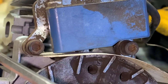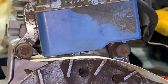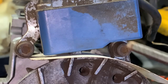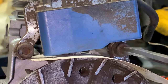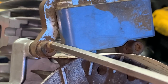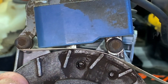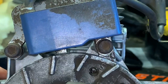That way the natural action of the clockwise rotation of the screw is actually pushing down on the coil — especially when you're in a hard-to-reach spot, that will help you out tremendously. You don't have to kill these screws, just get them taut. Then just slide out the business card and we have our gap.